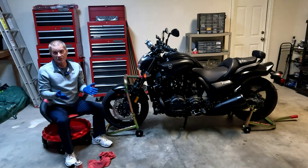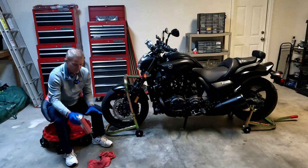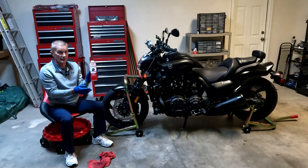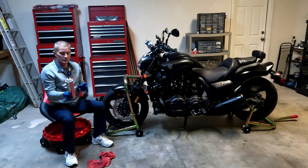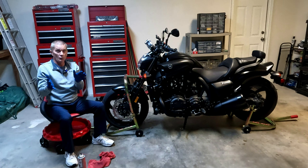Like I said, this wasn't a video so much on whether or not you should or shouldn't clean your brakes — maybe I've helped you decide. But I can't stress enough: if you are going to use some sort of solvent, particularly brake cleaner, it warns in the very small print — do not get this on any other components of your motorcycle, because it may eat through the finishes. So definitely be aware of that.